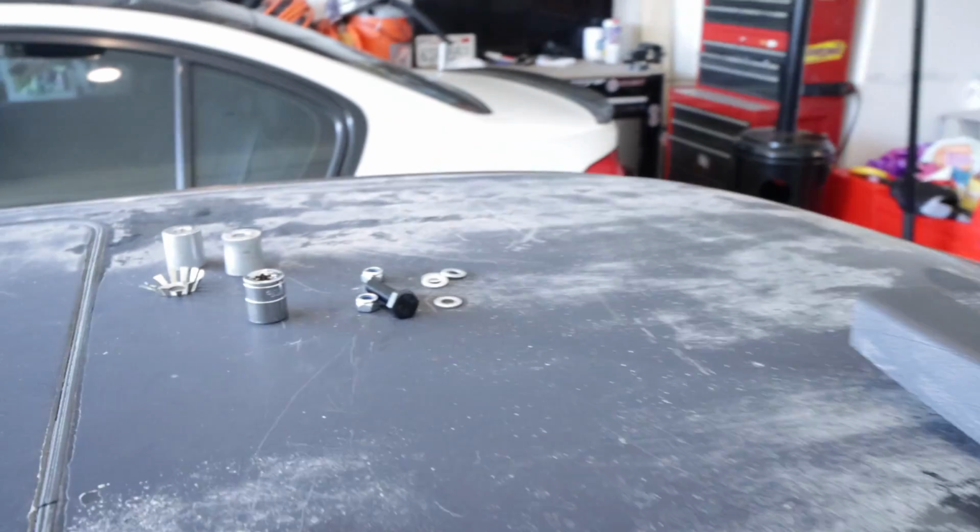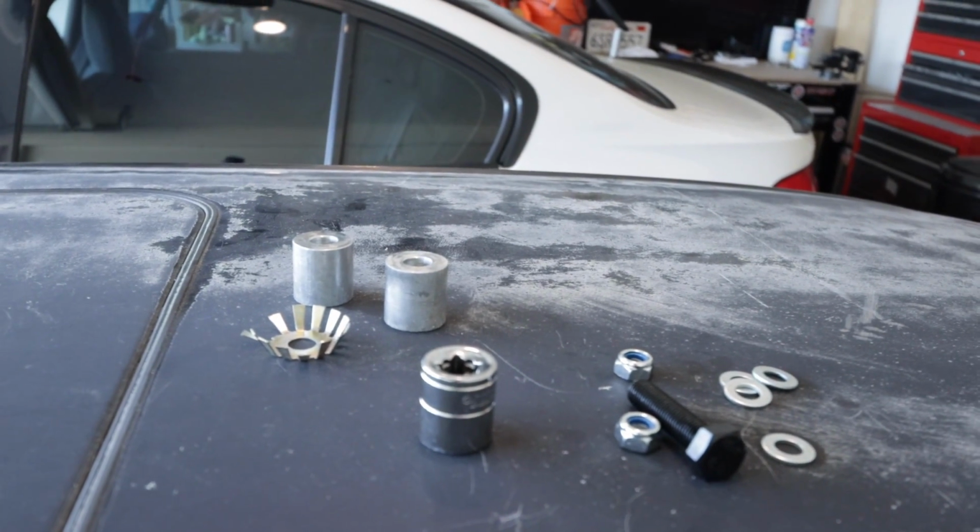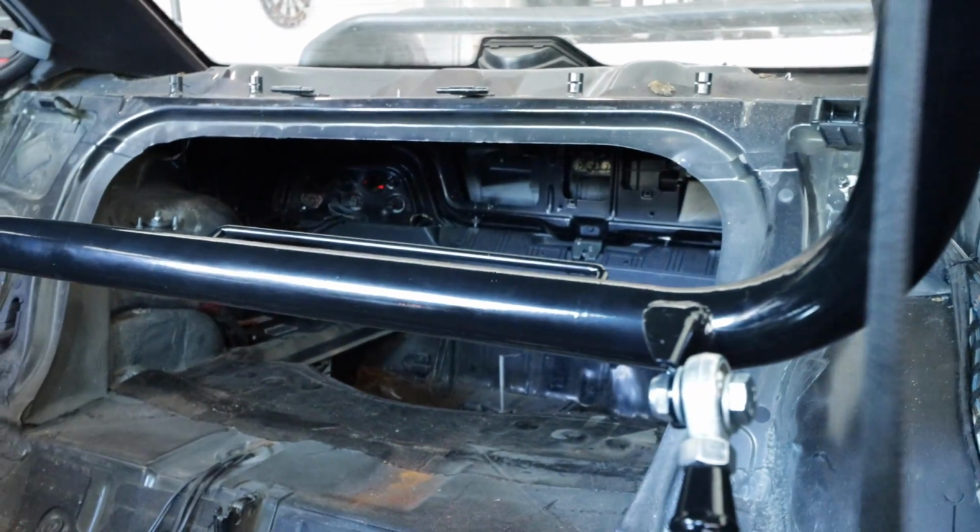And then I put in both the adjustable support braces here, and it goes down to the lower mount of the seatbelt adjuster. That's a T50 hex bolt. And then the Braum kit gives you a smaller spacer. The spacer on this one is pretty large, so they provide you with one that's about half the diameter of that one, half the width. And then it just bolts right in.